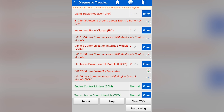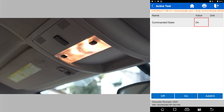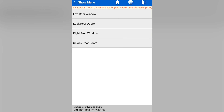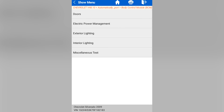The EBCM shows low brake fluid indicated, lost comm with ECM, vehicle interface module lost comm with restraints control — that's because I have an airbag light on all the time. The digital radio receiver shows antenna ground circuit short to battery — that's an aftermarket radio. Let's check bi-directional tests: body control module, interior lighting, courtesy lamp. Watch — turn that on, turn that off. Done with the scan tool. Doors: unlock rear doors, lock rear doors — that locked all the doors.